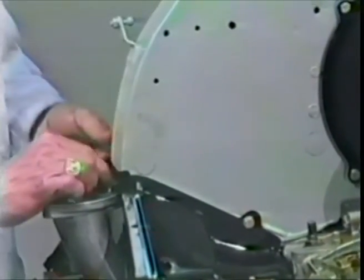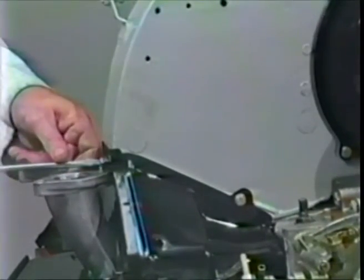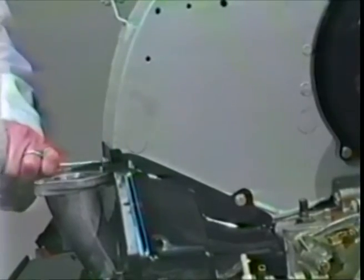Again, don't tighten it all the way down yet. And if you recall what I was saying, the side horizontal screws that hold the side vertical piece to the fan shroud are special. They're a 6mm bolt with a screwdriver slot. And of course, the maestro has them, and he uses them because that's what the factory used. And they go right in here. It's the only place that these are normally used, although I've seen some 912s where the guy who was assembling the engine used nothing but these particular type screws, because that way he could use either a screwdriver or a wrench on them. I wonder what the supervisor thought of that.